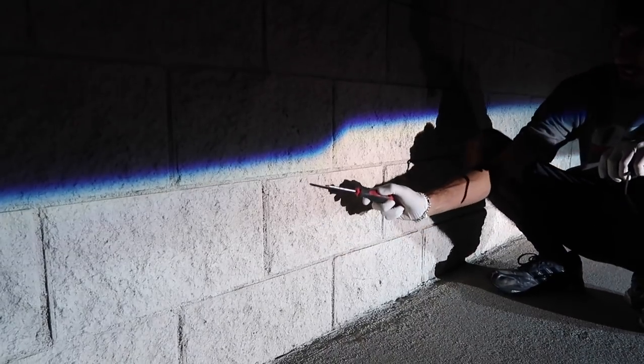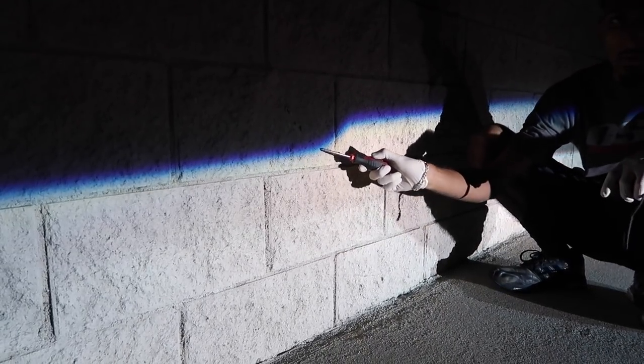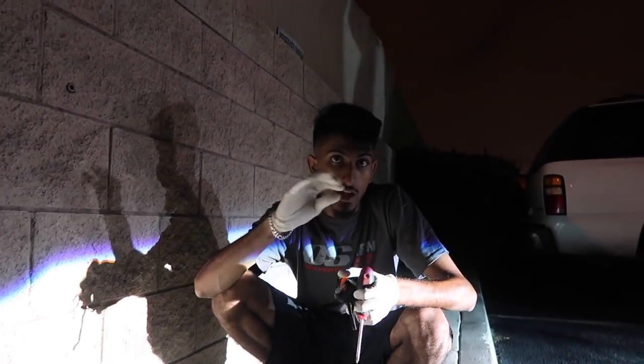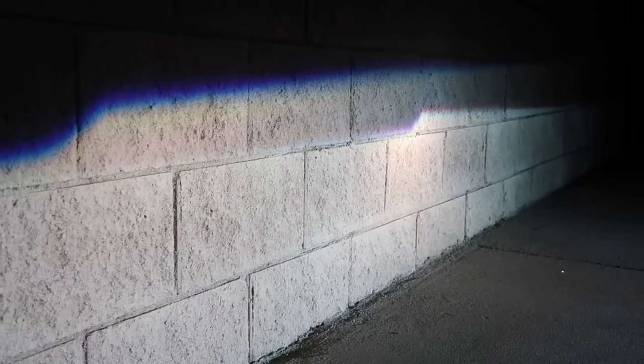The cutoff is at the second brick, pretty much where I want it to be. The projector looks a little bit crooked — remember when installing, make sure the top section of the projector is parallel to the headlight. Even a little movement when tightening can cause it to go diagonal. To fix that, just pull off the headlight lens — you don't have to pull the whole headlight off — then turn the projector just a little bit to make it perfectly even. Now both sides are adjusted exactly where they need to be.